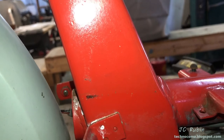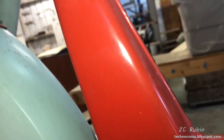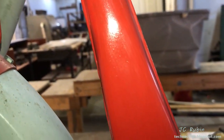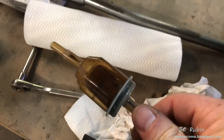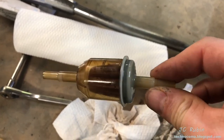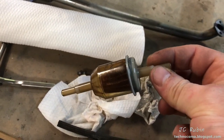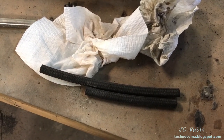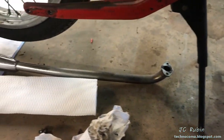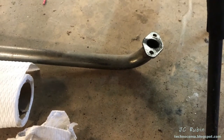I cleaned a little section of the frame and then applied two coats of wax — it shines up really nicely. I use Turtle Wax. The fuel filter was nasty — I cleaned it out and flushed it with gas. I know that's not typical but it's nice and clean now. Got new hose as well — just cut brand new slices, replacing the old pieces. I also took off the exhaust pipe to make sure there weren't any blockages. There was a bit of an exhaust leak right there — I'm going to shore that up. Put the exhaust back on and it was not blocked.